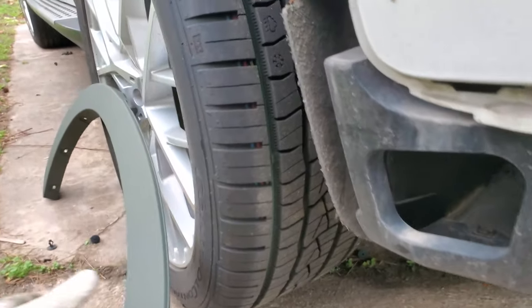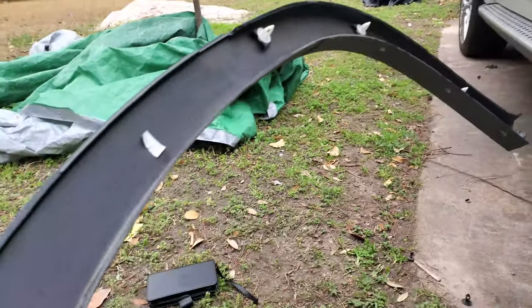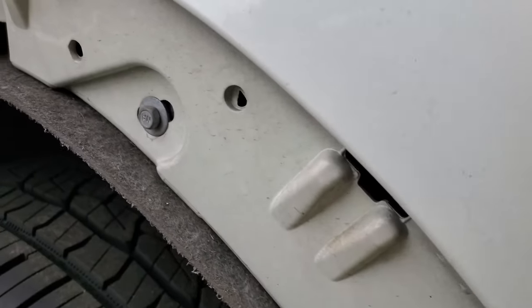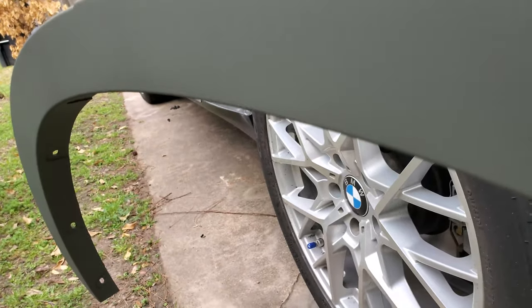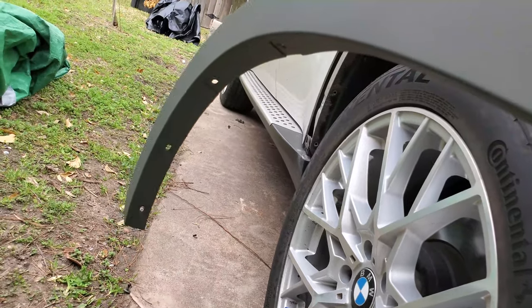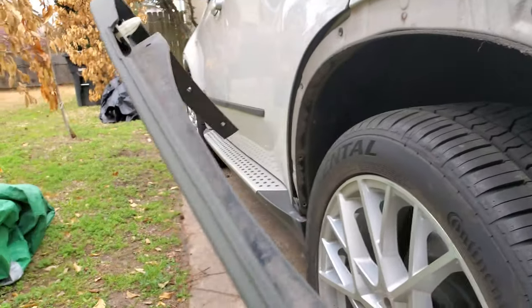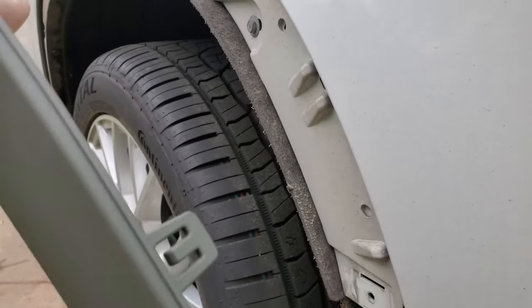As for this guy here, they've got pop-out fasteners and the typical pyramid or bracket things. They fit in these slots here, right? And what I did was I popped them out, pop out the underside rivets, these pop rivets that they use on this trim on the X5. And then I took the front, I ripped the front out first, and then once the front pop-out fasteners came out, I got to the rear ones, and they came out pretty easy.